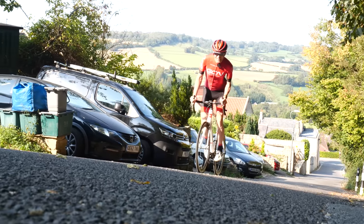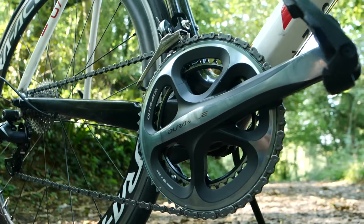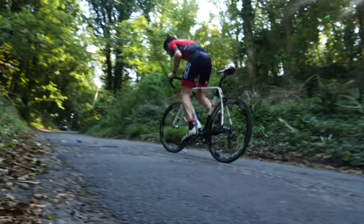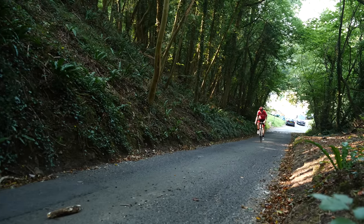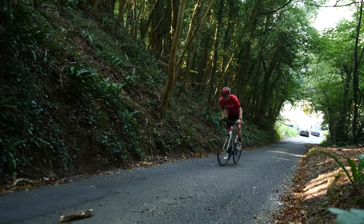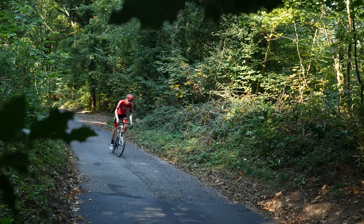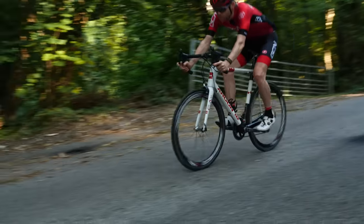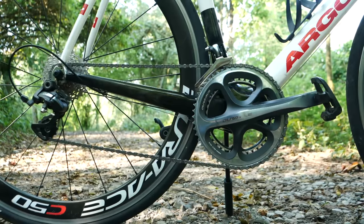Fun fact for you, this generation of Dura-Ace was actually the first to offer a compact chain set. But I don't have one here. Oh no, I've got a 53-39. And unlike the modern 105, I couldn't just swap my rings either, because it doesn't have that universal BCD. The cranks are different. So, if you want different size chain rings, you can't just simply swap the chain rings like you can do on modern Shimano group sets. You have to change the whole chain set if the BCD is different.